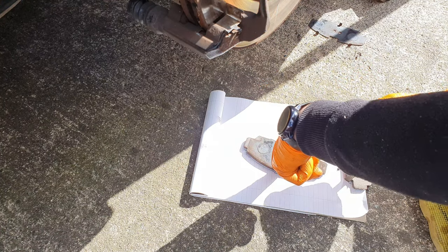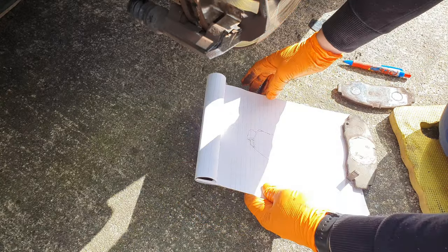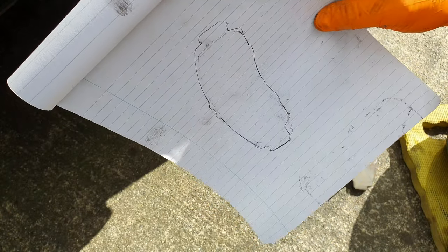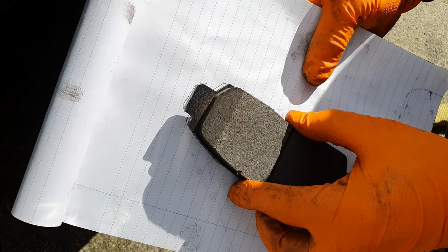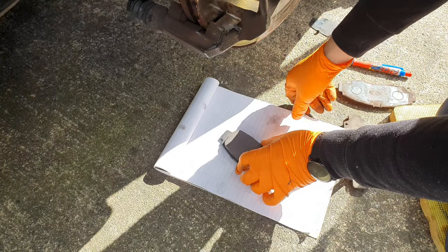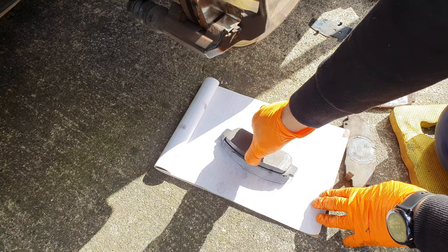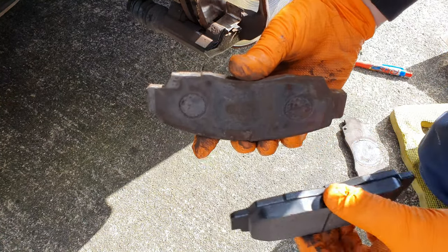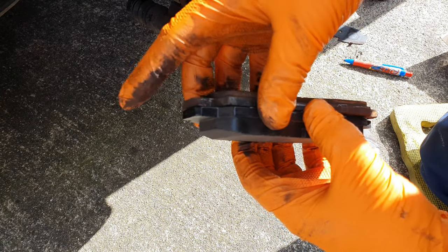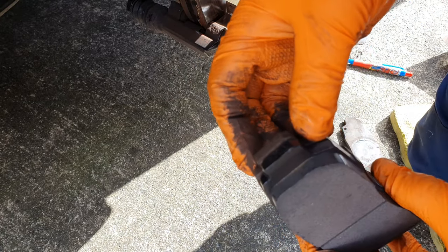Any little lumps you see at all, make sure you're close enough to the pad so you get every lump all the way around. It doesn't have to be 100% perfect, but as closely as possible. What you get then is your new pad shape. When you go to your parts shop, just ask them for new pads, give them your reg plate and chassis number, and when they give them to you, open it in front of them with your piece of paper and make sure they are exactly what you just traced - then you know they're going to fit.